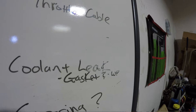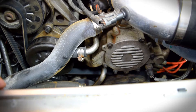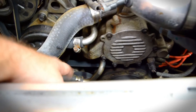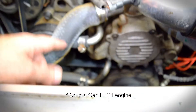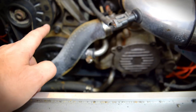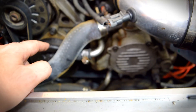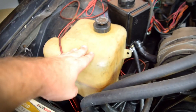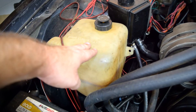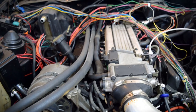Ask me how I know. If you suspect that your vehicle has a coolant leak, then the first step is going to be to identify the source of that leak. There are a number of places that you could be leaking coolant from. The water pump is a common one. You've also got heater hoses coming off of the water pump that run to your heater core inside the car — that's where the heat comes from when you turn the heat on. Check those hoses. You've got upper and lower radiator hose, and also a coolant overflow tank you can check. Between one of these things, you should be finding the source of your leak.